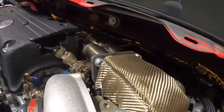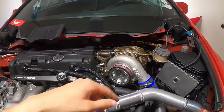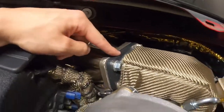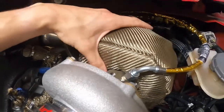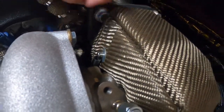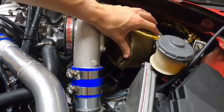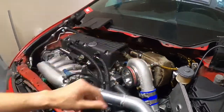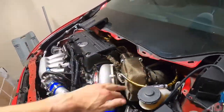Kind of dumb but I totally forgot we had a turbo blanket, so I slapped that on. When the cowling is back on you won't be able to see the rear turbo anyway. Not only is it ceramic coated for around 1500 degrees, it's also got a kevlar shield, so that should further help keep temps in the bay down. They're held on with these little springs that latch in — hopefully that saves our vacuum lines and wastegate from getting fried.